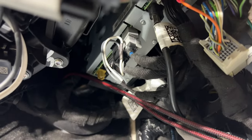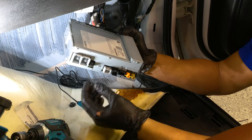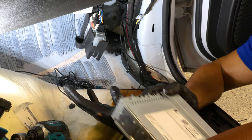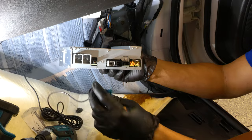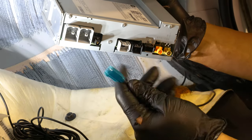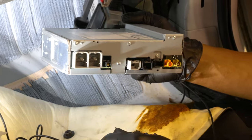If you look right above that spot, you'll see our radio module — this is what we're swapping out for our new one. Basically what you're going to do is unplug all of these plugs. Right around in this area there's a plastic locking tab — just pull that to the side and this whole module will slide out of its housing. One thing to note: make sure the antenna line gets plugged into the curry-colored connector on our radio module, and the camera line goes into the orange connector. That would be the only thing you could get wrong. Everything else is a keyed connector and they'll only go in one way.